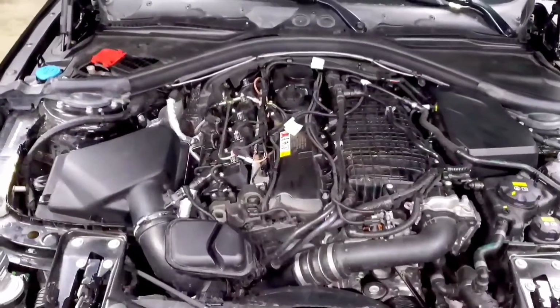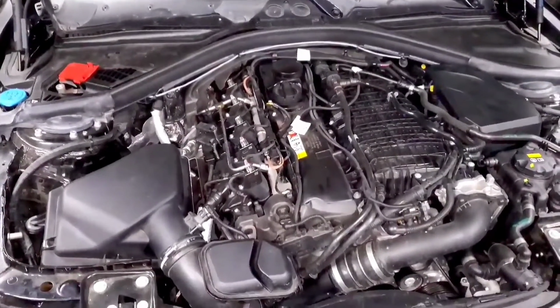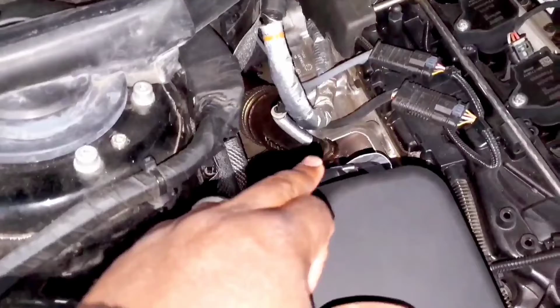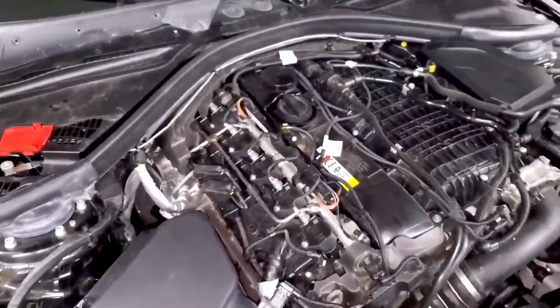So finally, we'll talk about fueling. The most important factor dealing with fueling is your AFRs. And that's measuring the air-fuel mixture that's coming out of the combustion chamber. So you're going to look back here, basically this first sensor on my downpipe. That O2 sensor is reading my AFR readings.